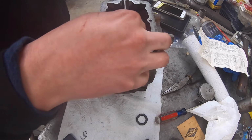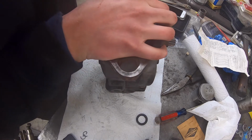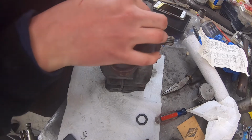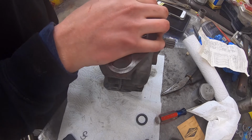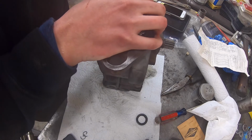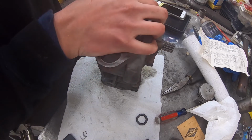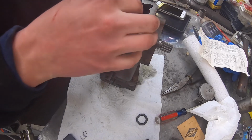Maybe down the road what I'll probably do is get a set of spare 30 thousandths oversized rings, and then when the time comes, if I still own it, those rings will get put in this engine. Okay, and we're at 100 inch-pounds there. We're at 100 there. Okay.